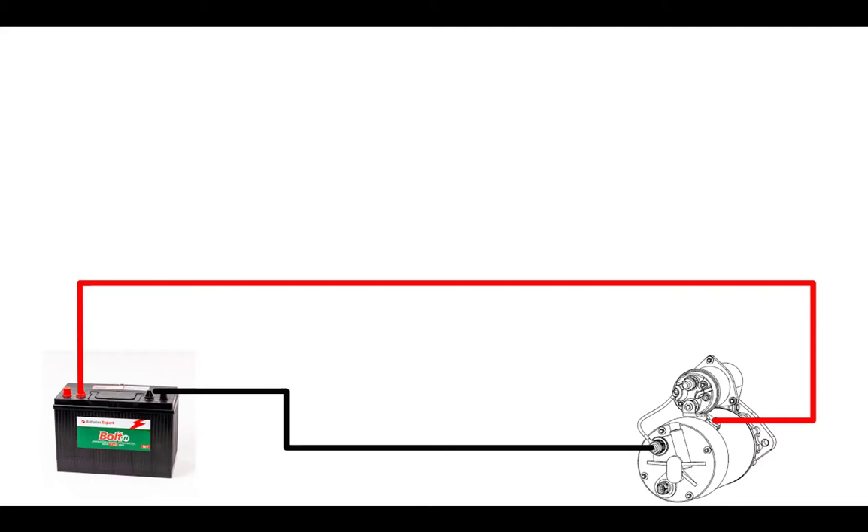The other thing we need is that when the starting motor is engaged and the engine is cranking, it'll crank at about 250 RPM, but when the engine is idling it will be much higher than that, and of course the engine is going to rev up faster which is going to over-speed the cranking motor. So we need some way of engaging the cranking motor to the engine and then disengaging when we don't need it — turn the motor on and off. That's going to be the job of our cranking motor solenoid.